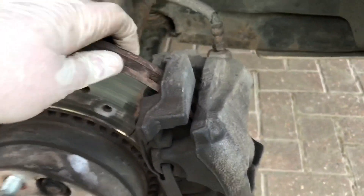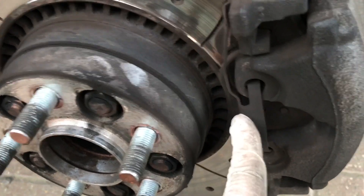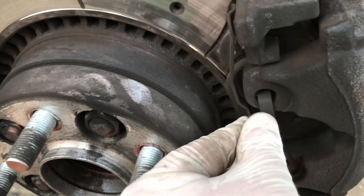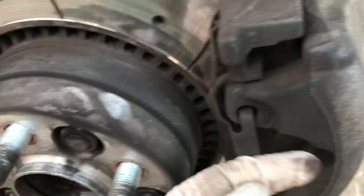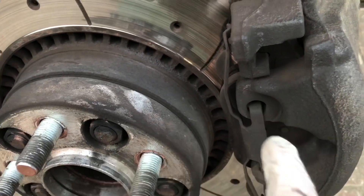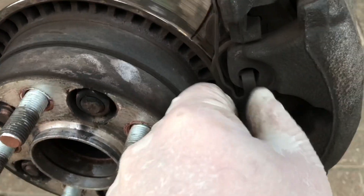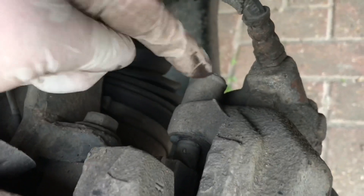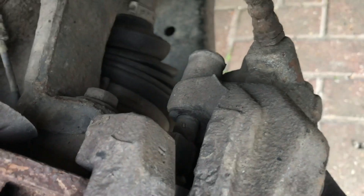What we need to do is remove the spring. The easiest way is to push it forward, push it sideways, and these bits have a little hook that just pops out of two holes. The spring comes out round the back — there's one there and another one underneath.